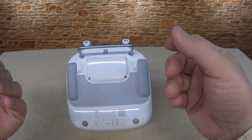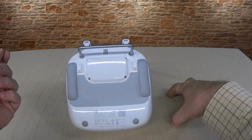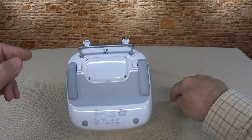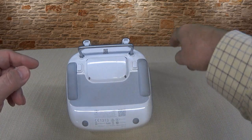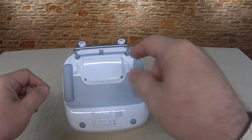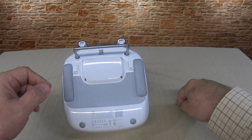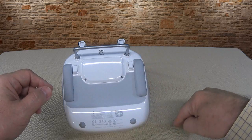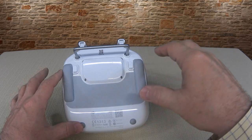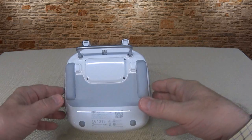Now, one other thing I'd like to note, and this is just a practice for me, whenever I do a project like this, I always try to work on a surface that's got a little bit of friction to it, because if I work on a kitchen table or a wooden table, I find that those screws, which are really, really tiny, if you put them down, they're going to wander. And if they wander off the edge of the table, you're going to have a dickens of a time trying to find them. So what I tend to do when I do these type of projects is I'll take these 4 screws off, I'll put them in a pile together, I'll put the cover near it so I know they're related to the cover. These 3 Phillips head screws will go in a second pile, I'll put the printed circuit board near that. Same thing with the case, I'll put the case aside, put the screws near it, and that way when I reverse the process later to put it back together, it's obvious to me where all those screws go.